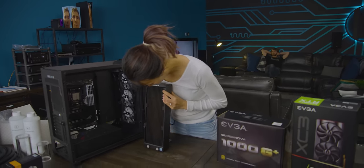All right, oh crap. Okay, I'm going to take the motherboard out, bend the pins back, and then I'm going to put this connector in without bending them. Watch me. There's supposed to be one pin missing in the corner here, so that's fine. So it's just this one right here that got a little off course.